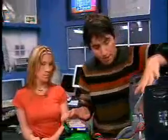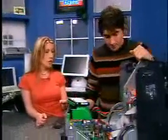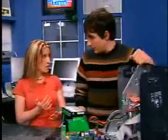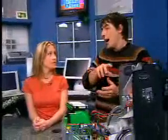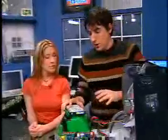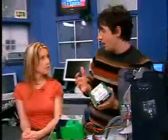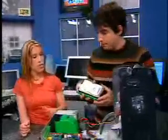So you have a choice here. You can either swap out the drive that you have and put in your fresh drive, or you can add storage — another 300 gigabytes as a D or E drive to store all your videos. Which is what we're doing here because we've got the room. If you wanted to take out a whole drive and put in a new one, you'd have to use a program like Norton Ghost to copy all the data from the first drive to the second. You can't do that when Windows is running because your files are all locked up — you can't just drag and drop your Windows directory. There are hidden files and special files for booting. You have to boot from floppy disks so that Windows isn't running, and then Ghost will copy all the data over. We have instructions on how to do that on the TechTV website.